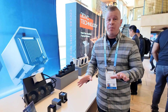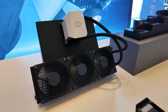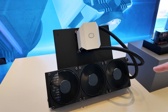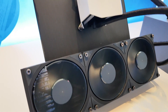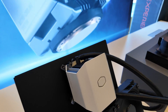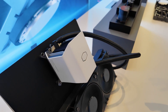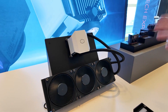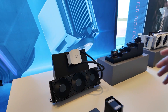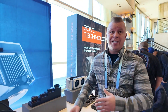Moving on, we have the Project G11, and this is a very high-end AIO cooler. It features their Mobius fans with no RGB lighting. The cool thing about this AIO is the pump block design — it's a dual pump, dual chamber design, so you have the hot liquid and cold liquid being separated, which gives you a lot better performance. They're targeting anywhere between 300 and 320 watts for this. No word on pricing, but it should be available sometime towards the end of the year.